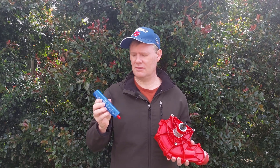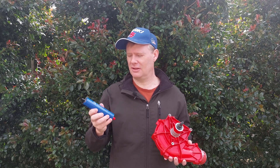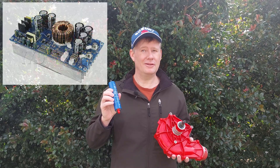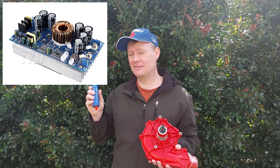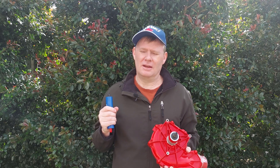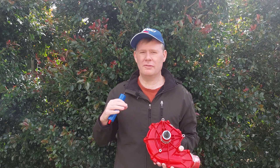With the relocation of the car battery, I may actually end up with a bunch of these in the engine bay instead of relocating to the boot, because one set should be enough to start the car. But these are only 6 amp-hours, so sitting for a month could flatten them. We may have a buck converter to take the power from the 18 supercharger cells back into probably six of these to power the car. I'm going to do this via Arduino programming, with one in the engine bay to power the ESC and one in the boot for charging. I'll definitely be running a proper BMS.